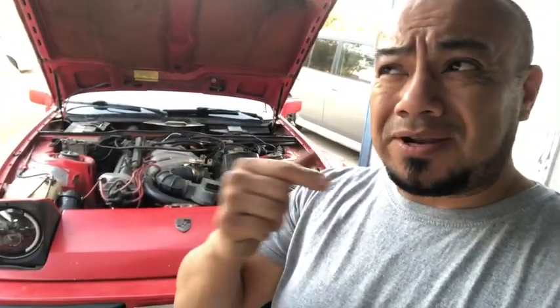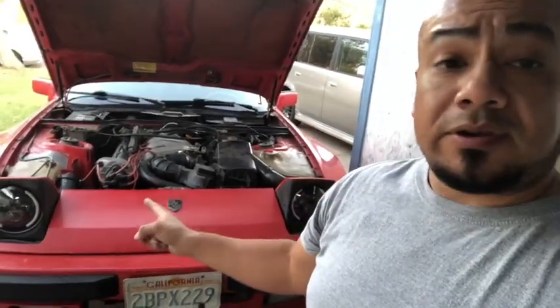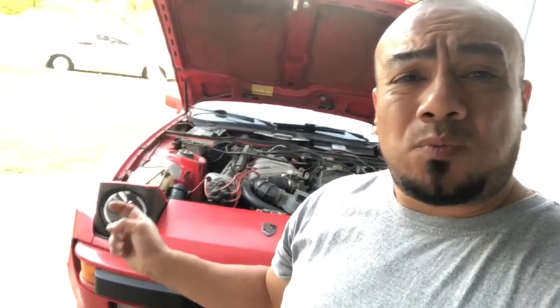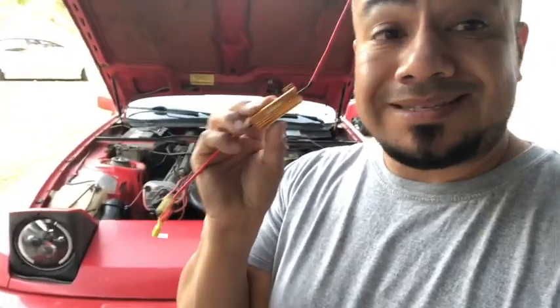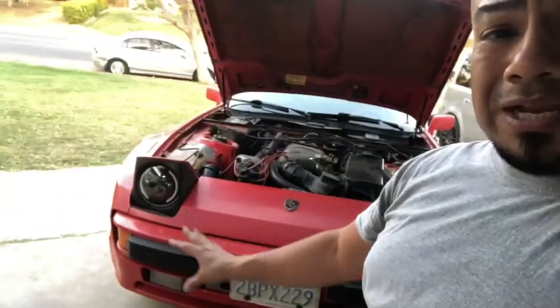This video is going to be in two parts. Part one will show what they currently look like when running, and part two will be the original videos. Also, if you're going to be switching to LEDs in a halogen environment, you will need resistors. The ones I got are available on Amazon — you need 50 watt, 6 ohm resistors. I'll show exactly what I did to tie into the harness, and then show the older videos for reference.